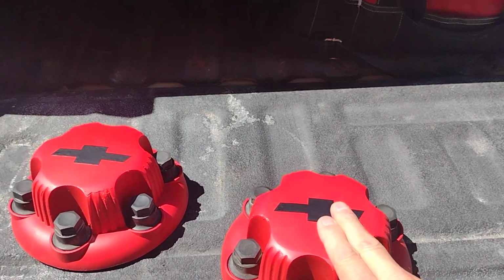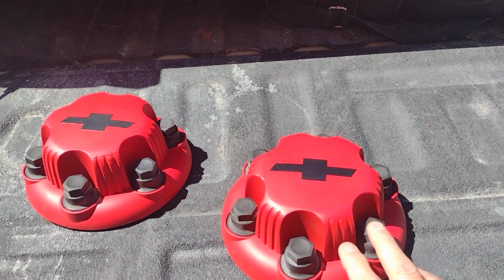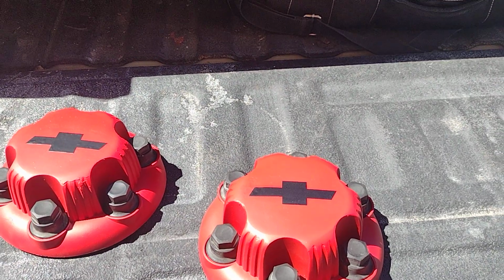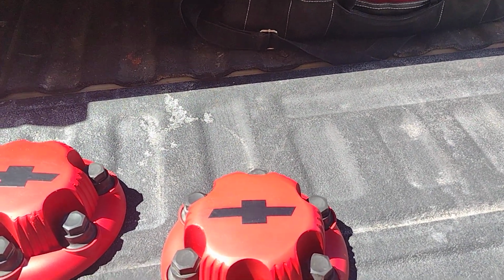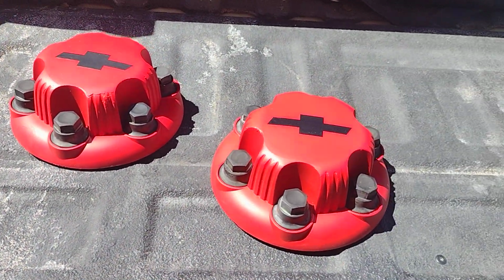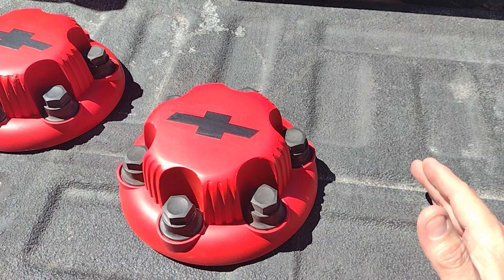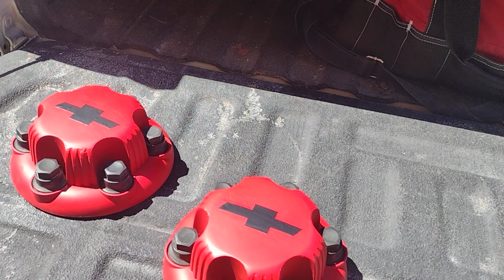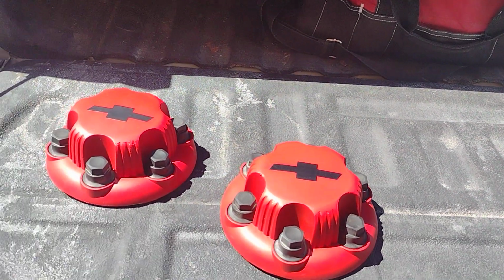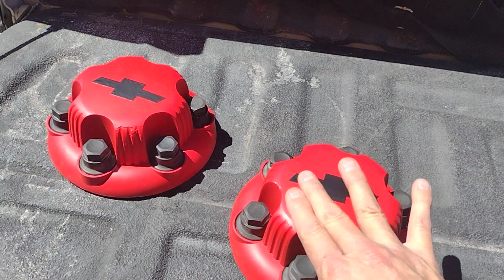I was going to use Bondo, and I'm thinking to myself, great, I've got a can of Bondo. One of the Lowe's employees made that recommendation to me. It's only about two years old, five years old, whatever, but it's never been opened, so it should be fine. Yeah, no, it wasn't. So I used the hardener from it to mix with my new can of fiberglass body filler. When I mixed it up, the Bondo hardener was red or pink, so the fiberglass was now kind of pinkish.